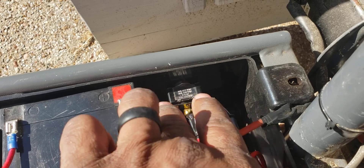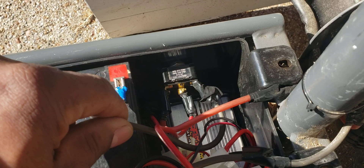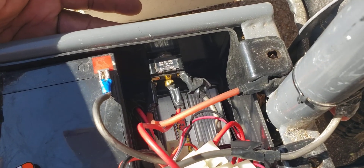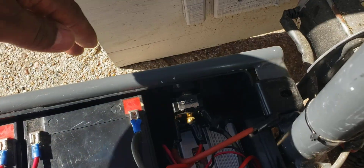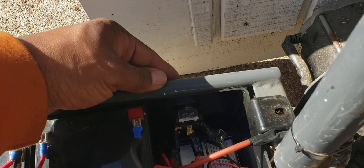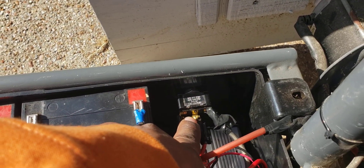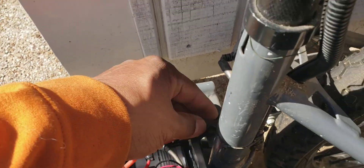Then you're going to have a wire on each side. When you flip the switch, it completes the circuit on that side. So forward means front batteries; you flick the switch to the back, it completes the circuit for the wire running to the rear set. It goes up here to those batteries.